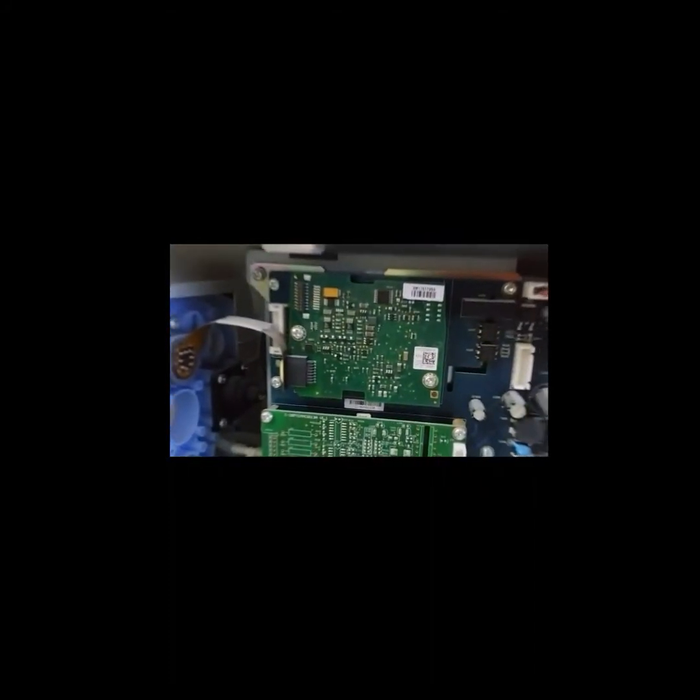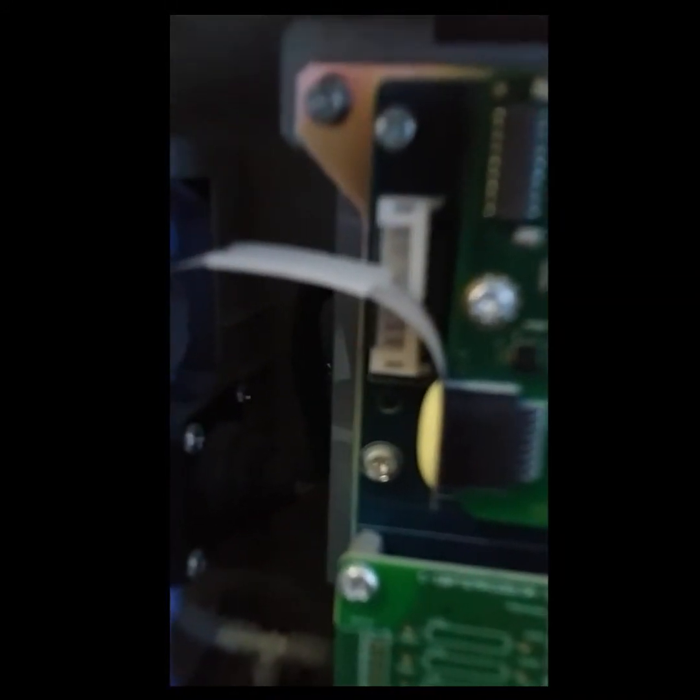We have there the BP tubings, and this is the board from the monitor display. There is the BP tubing. We're going to pull out the frame — there are four screws here, and I think there's another screw from the bottom of the monitor, so we're going to pull that out. We have here the tubings from the BP; we're going to check that, and these are the screws that we're going to pull out — there are four.